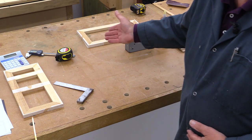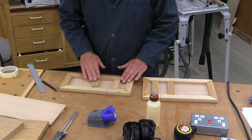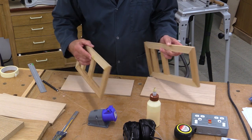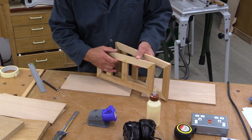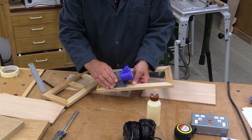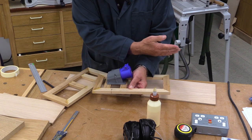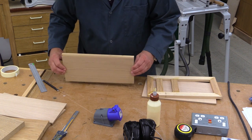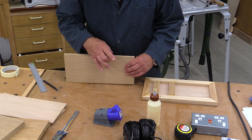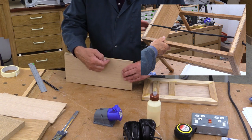I'll leave that to dry and do exactly the same for the other one. I've very carefully marked which is the front, top and outside of both of these. The outside is there and there. This is the one that takes the ordinary socket biased towards the front, and this is the one that takes the pair of 16 amp sockets - or in fact one's a socket and one's technically a plug - which are going here, and then the cables will run back towards the vehicle. I now need to stick the inside piece to each of these so that once it's stuck on we can cut the holes for the cable to run from the sockets on the outside through to the top.